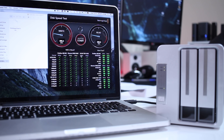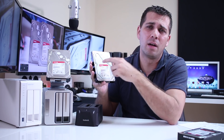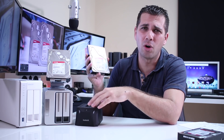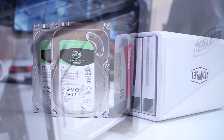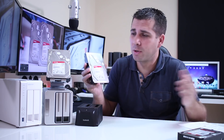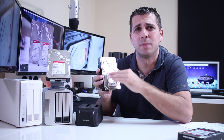We are using a hardware RAID configuration, by the way. Usually we don't use NAS hard drives in single-disk configurations with a USB dock or RAID setup, and I don't advise it. But if you ask me whether you should get the Seagate I reviewed last week or the Toshiba N300 — which is supposed to be a NAS unit — to use as a desktop, my answer is: why not? The price is very competitive, and the speeds are very similar, even superior to some desktop hard drives.